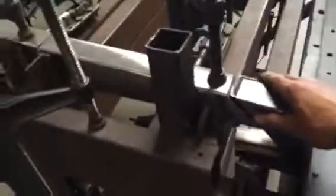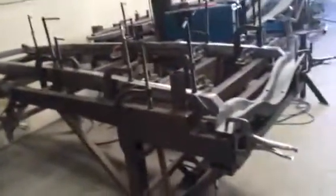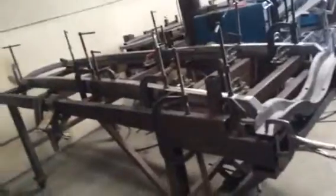So it's lower than the original one. We're going to also finish boxing it right here. As you can see we put in this plate in here. I'm going to clamp it a little bit more, weld it, and then get it out of the jig and show you guys how it came out.